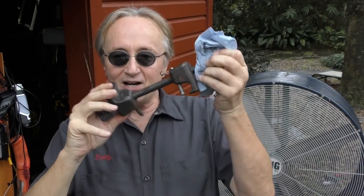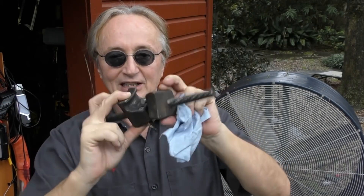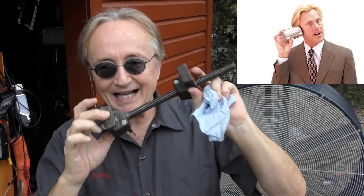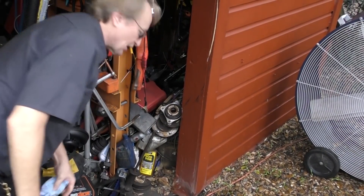I found that the simple ones are actually safer than that giant machine. Years ago I was using the giant one on a Volvo, and those skinny little arms slipped and it ripped my finger the whole way around — pulled all the skin up. You could see the bone under there, and I thought, I don't like this machine anymore. It worked out fine, my finger works fine. So now I use this thing that costs like forty dollars to do struts. It's safer, I've never had a problem with it — simple, cheap technology that works.